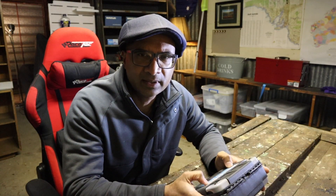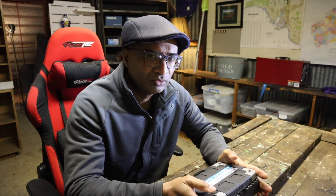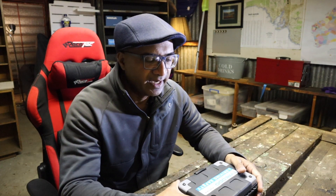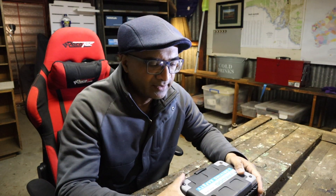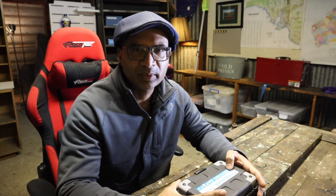So I'm about to unbox it and then have it installed in my 4x4. Tire Dog has a number of different models you can pick from — I'll leave a link to their website below. The model I've got has four sensors, so it'll give me tire pressure readouts and temperature readouts for four wheels. And the moment one goes below or out of range compared to the other three, it'll give you a warning. That's where the beauty and the importance comes in.